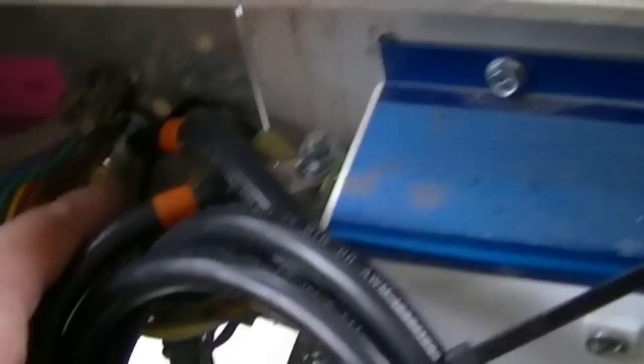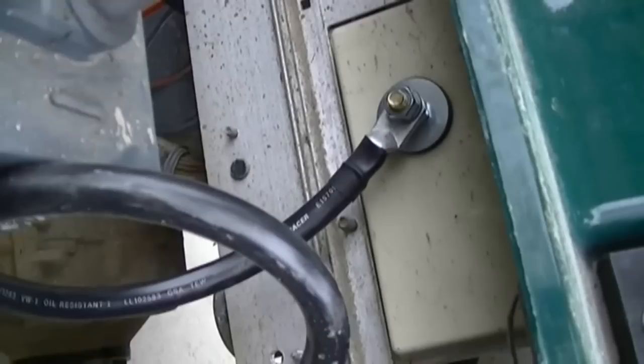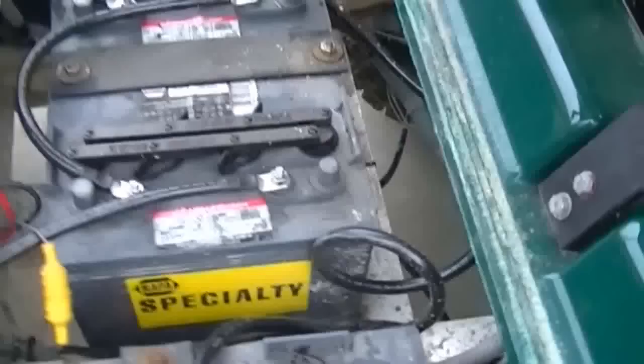All right, got that done. You can see I got the bolt through there. This is not tight through that computer — those rubber washers are just snugged up a little bit on each side. The nuts are tight on the cables. I wish I didn't have this long loop of cable, but it won't hurt anything. On the inside, that's what it looks like going through the computer. Now the computer will be able to read the voltage properly, and I don't have anything bypassing it, so the charger should work a lot better.